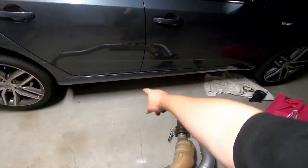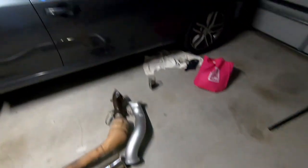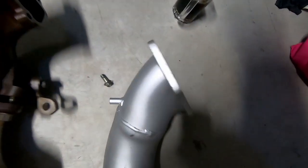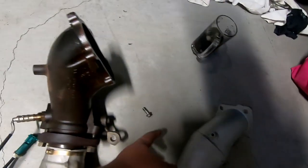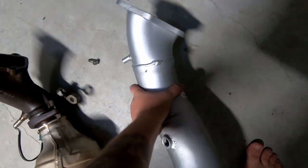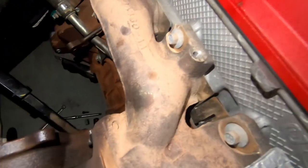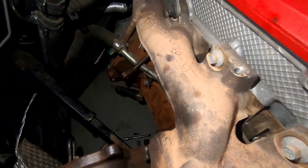The most painful part's done. Close the garage door up because it's getting late, jack the rest of the car up, and now I'm going to start smashing out the whole rear end. I've noted that on the factory manifold there's a bolt for the heat shield, and the aftermarket one has the same bolt hole — just copy across and check what's missing. The aftermarket one hasn't got any braces for the dump pipe like the factory one, so I'll knock those brackets off. I won't start fitting the dump pipe or anything until I've got the rest of the system here.